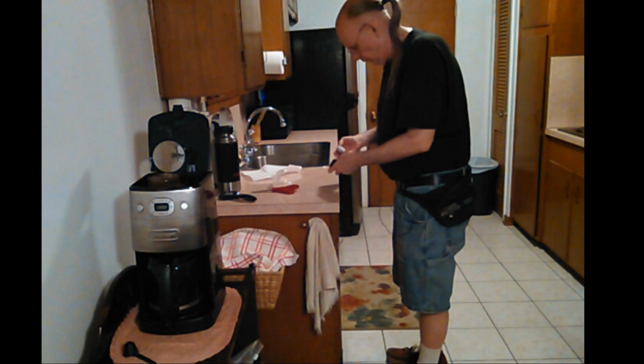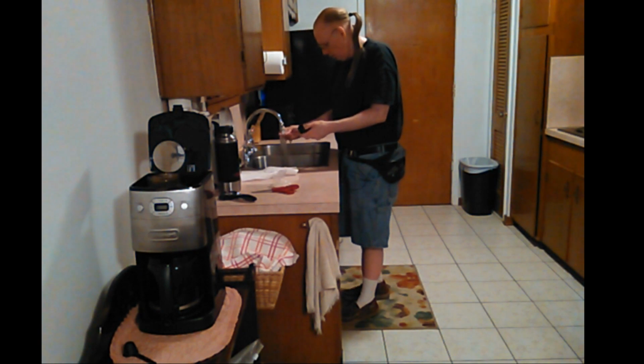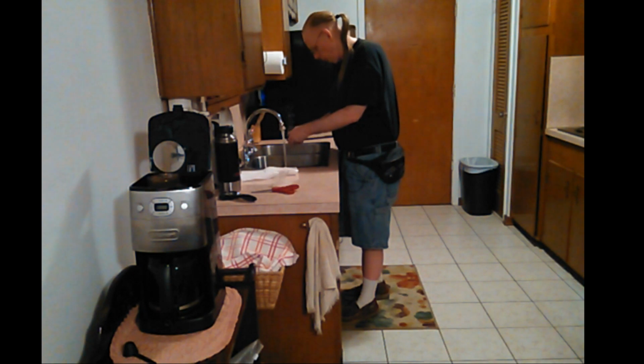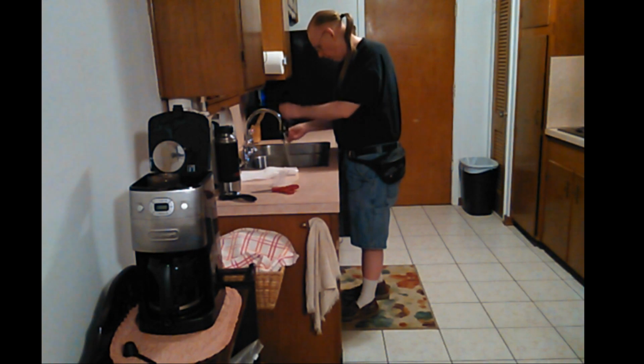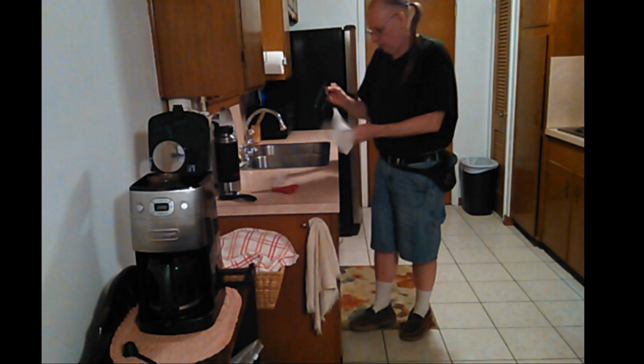get too close, you won't even see. I hate to change them if I don't have to, but you do need to soak them down. Try to rinse all the dust, the charcoal. These are charcoal filters, so there's a little bit of charcoal dust in them. So I try to run water through it and clean it down as good as I can.